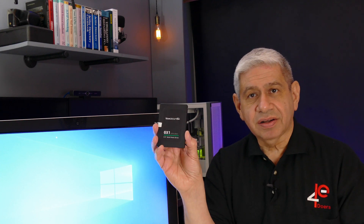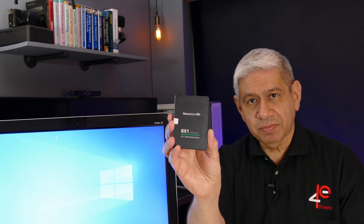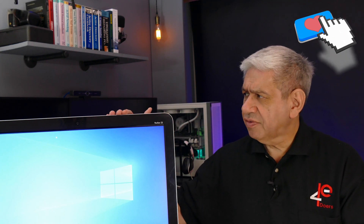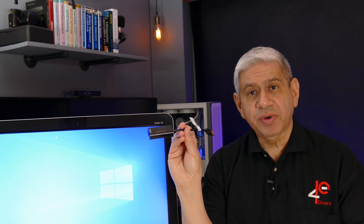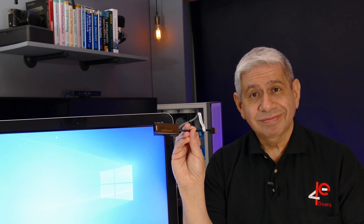What I'm going to do today in this video is upgrade it to a solid-state. I have this 480-gig solid-state drive from Team Group, to replace the hard drive, which I believe is a 500-gig hard drive right now. And since it has two working USB 3.0 connectors on this side, I'm going to use this adapter to convert USB 3.0 to a full 1-gig Ethernet. I'll show you the test results before and after.